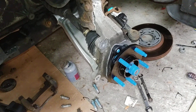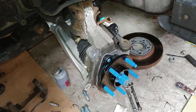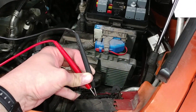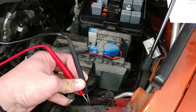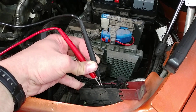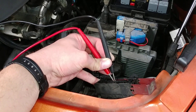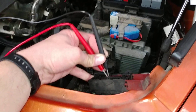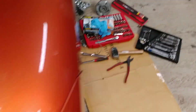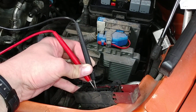I've got the new assembly — mounted hub bearing and ABS sensor — replaced the wire as well. I had a bad wheel bearing on the passenger front and replaced it with two new GM, I think it was FW299. About three months later I started having ABS and traction control lights coming on. Measured the resistance of the old hub and it was 27 mega ohms at this connector right here — it was affected by water.